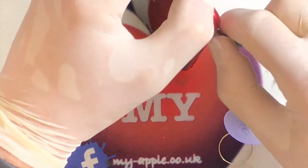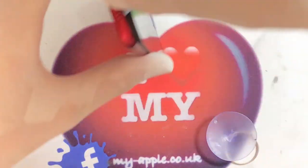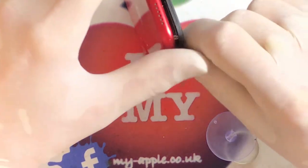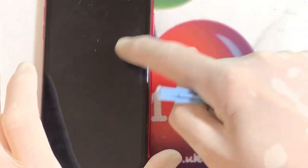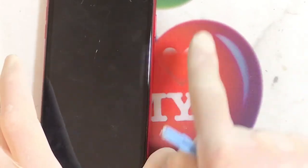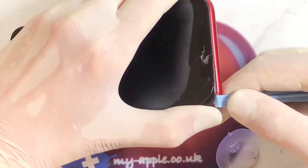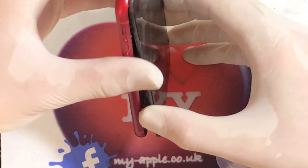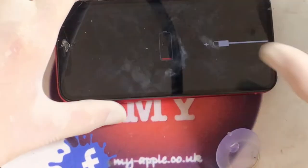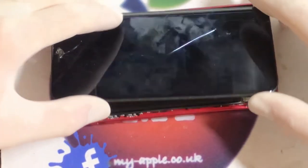Let's get one of these little plastic pry tools to open it up. Be very careful of your display cables, which are on the right-hand side of the phone, just where I'm going down now. The display cables are located here but they swoop down from under the phone itself. Also be careful around the top with the cameras and your Face ID module. Yeah, that came off way too easy — it must have had a screen change before.